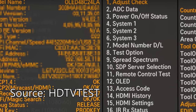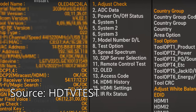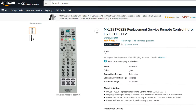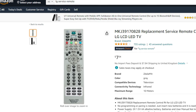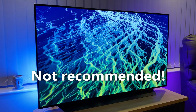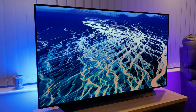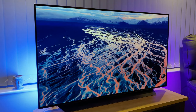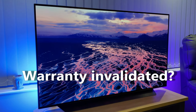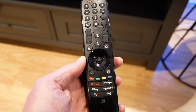I must stress that I will not be covering the LG service menu in any depth here — that's for another video. If you do want access to this menu to turn off things like auto dimming, then you'll need the service remote. You can pick this up from Amazon, and I'll leave a link in the description. I don't recommend accessing the service menu unless you know what you're doing, as it could mess up your TV or invalidate your warranty. This doesn't apply to the following hidden menus, which are easily accessed using the standard remote control.